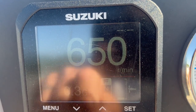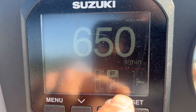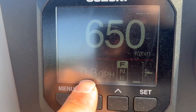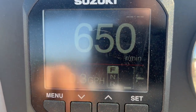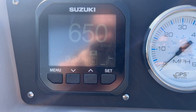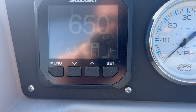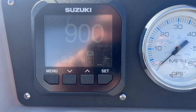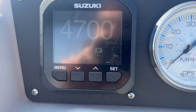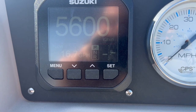Once this goes up to the top, I've actually got my tilt left on the motor and it can go a lot farther. Keep in mind that's just the bottom — maybe 10 or 12 degrees of trim — that's what you're going to be looking at. You get to see my fuel flow too; it's going to be up pretty high when we're wide open. I'm going to get it going and when I hit about 5,000 RPM I'm going to trim. I'll trim it up about halfway, then pin it all the way to full throttle, then I can trim out a little more from there.